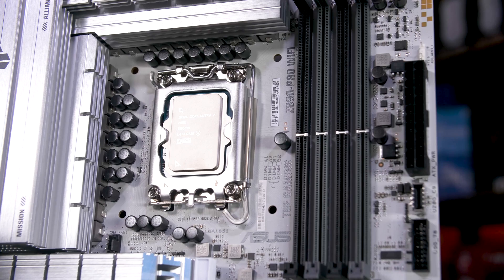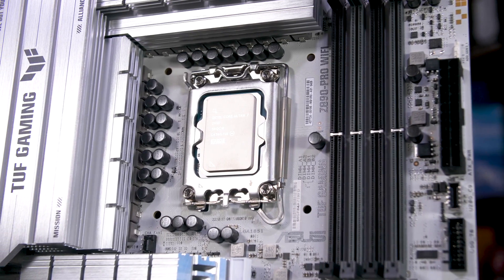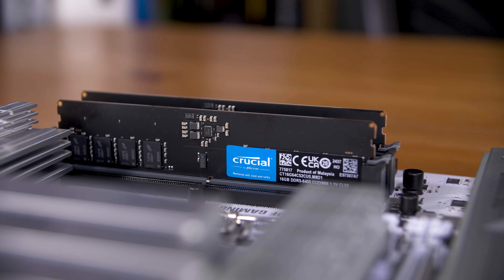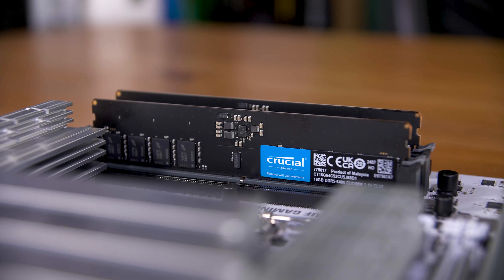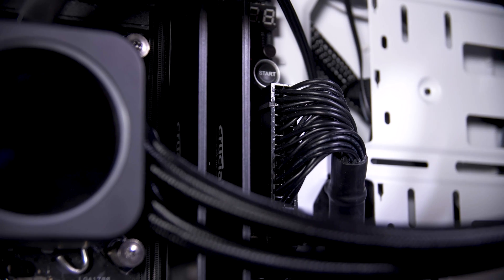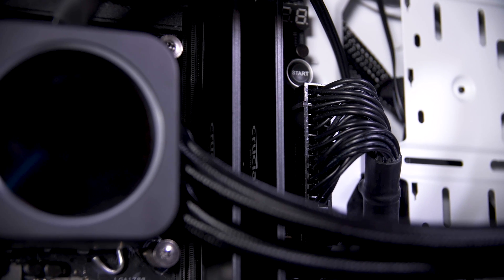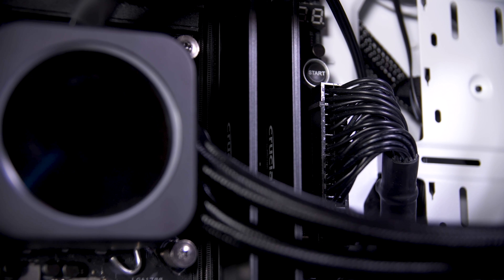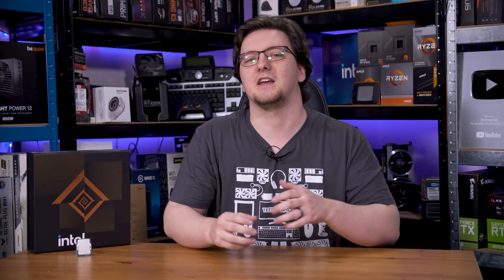In this video, I'm doing something a little different. Considering all of the big channels will be thoroughly testing these against its rivals, I thought I'd do some practical testing with memory speeds, especially since the new CU DIMM standard is here. I have a 6400 CL38 kit and the Crucial CU DIMM 6400 CL52 kit, with the 6400 standard kit having a secondary XMP profile that runs at 6000 megatransfers per second at a lower CL36 latency. I'll also throw in 5600 at CL36 as well.